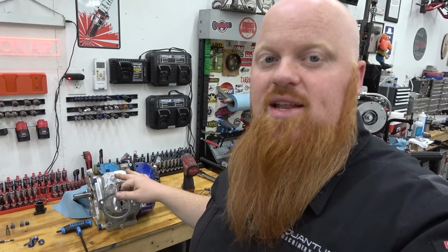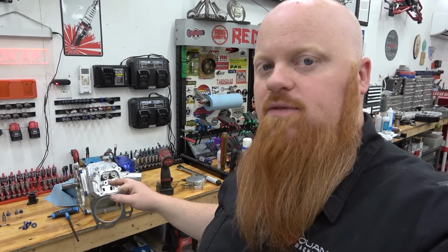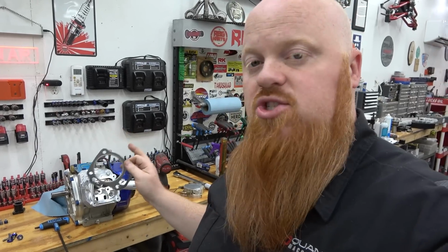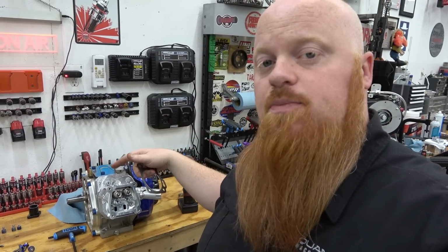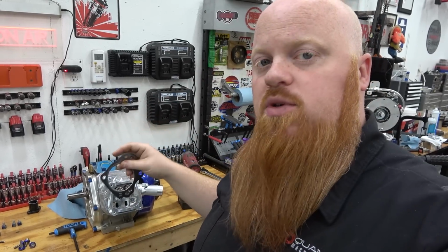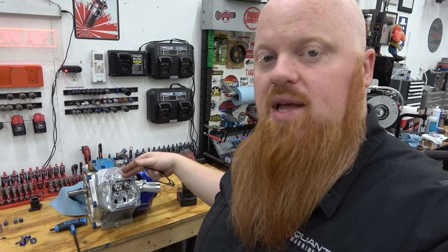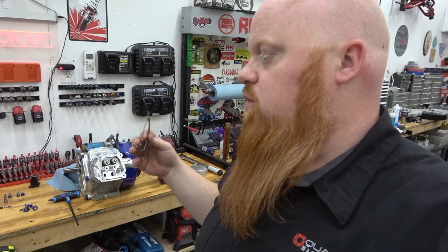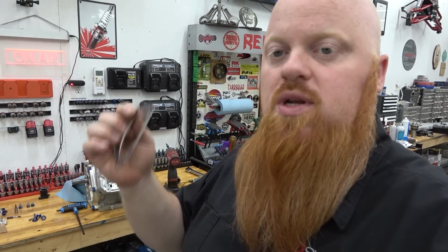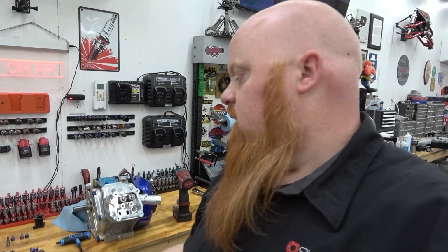So we have the billet head all installed. I'm actually going to be pulling it off in the next video and installing a firing gasket instead of the sheet metal one, because of the temperature differences. I was told by an engine builder at Go Power Sports that because this is a billet head and it's a lot thicker aluminum, it flexes differently than the block, of course, and you can get head gasket leaks with the thin one. So we're going to go with the firing gasket instead.